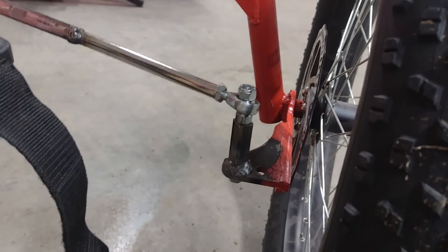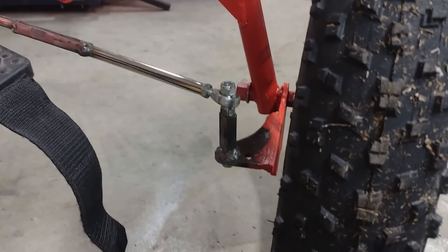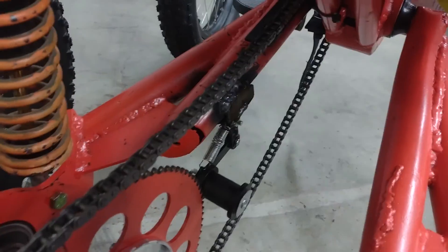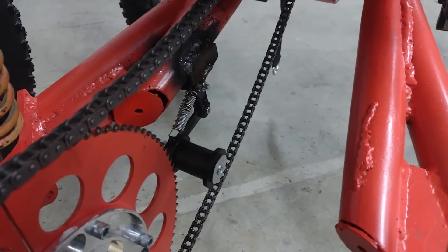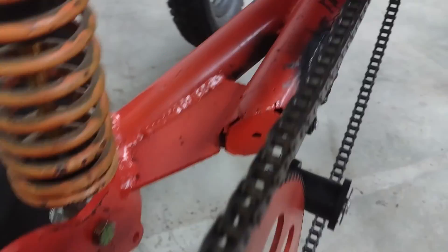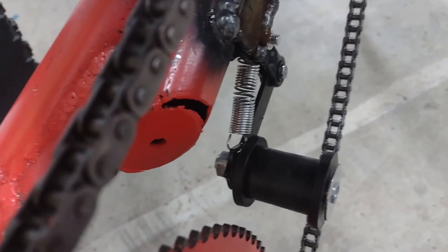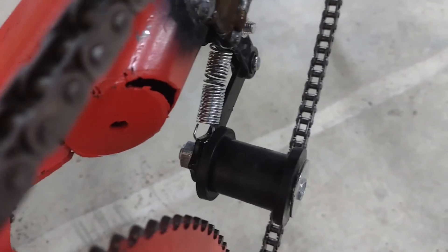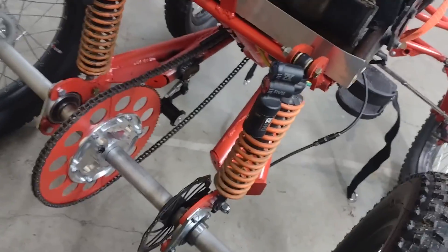Here's the modification to the steering tie rod that we had to level out so that we got rid of the bump steer. Here's the chain tensioner that we welded in to help with chain tension. Right now you can see the chain is off of it, but it was helping until the chain tensioner spring got busted — see that right there, the spring is broken — so it's no longer putting enough tension on our chain. If you saw the most recent videos where we were losing the chain, that's the problem right there. We need to go ahead and update that.